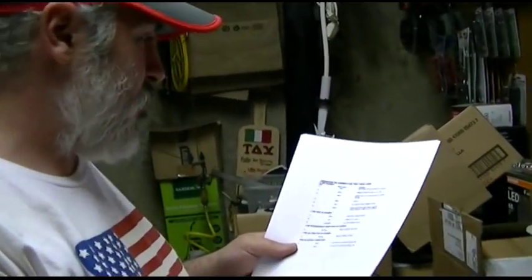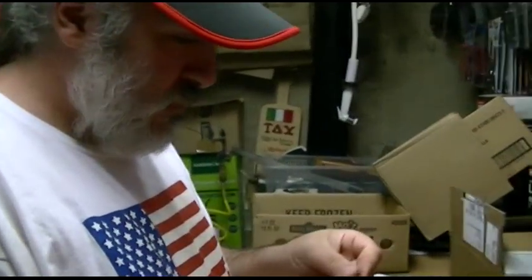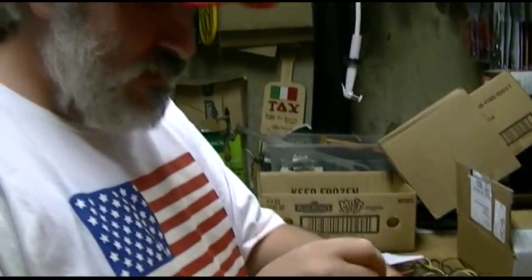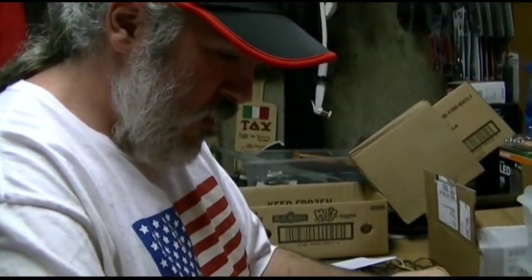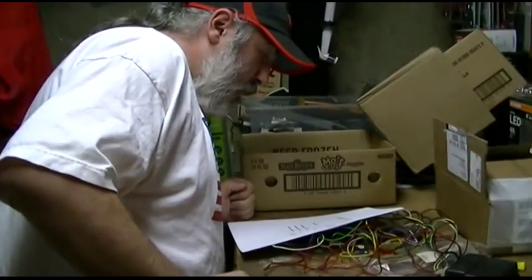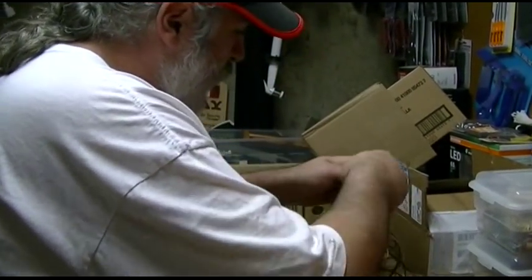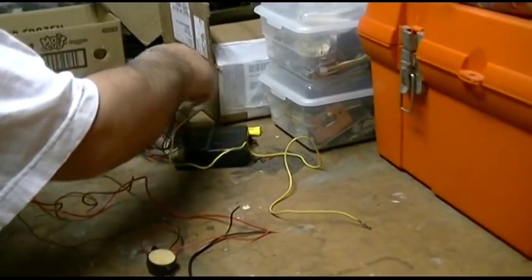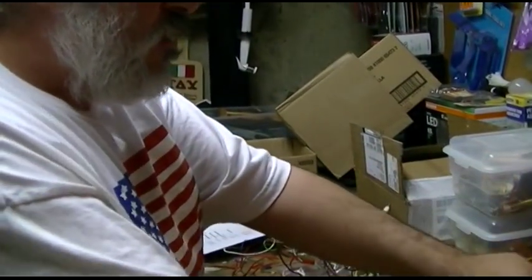The red wire is hooked to constant power. Brown wire is negative output for siren or car horn — so that's going to be the negative on that. The positive will have to go to constant because it's pulsing the negative. Yellow wire is ignition input — we're not really going to do that as of yet. We're going to just see if it works, but I'll put the wire aside. It's actually got a terminal on it, so I'll get a clip wire on it and hook it up as needed. We'll just leave that over there.